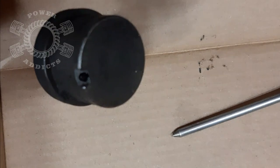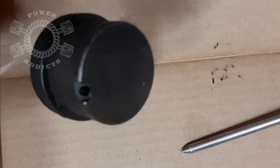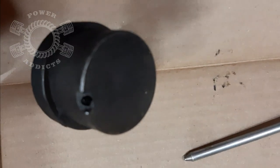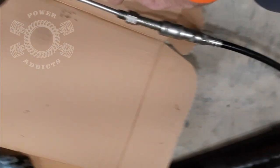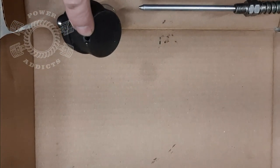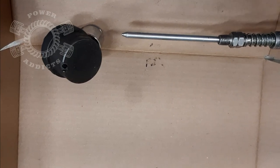Right there in the edge of that ball joint you can see that hole - there was a grease fitting there, but whenever I put the new ball joints in I had to take that particular fitting out, otherwise it'll scar off the lower seat if you try to press it out. So you squeeze the handle on the grease gun, it comes right down the tube through that tiny tip, presses on that fitting - because you're forcing it on there and holding it tightly it forces grease through that fitting into the ball joint and greases everything up. You've got many times too your U-joints that use that same fitting.